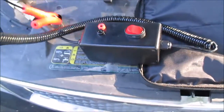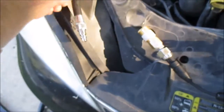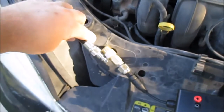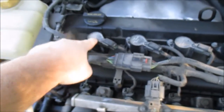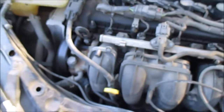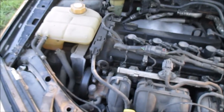I'm going to hook this up to the battery when I'm ready - it'll get battery power and then I'll screw this into my spark plug hole. I'm going to randomly pick a cylinder, pull the coil pack, the plug, and also pull the fuel injector while it's running so I'm not just squirting fuel inside the cylinder. That's what I'm going to do, so let's get busy.